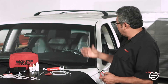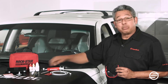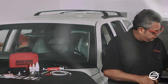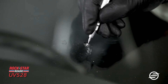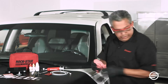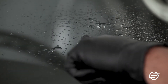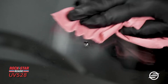The first thing we want to do is clean the break. We're going to use our scribe or probe to remove the broken particles. I'm going to put my safety glasses on and my nitriles on. Then I'll go in and take out the broken glass with my probe, get a paper towel and wipe it off, then put my finger over the area to wet it a little and clean around the area where the pad is going to come in contact with the glass.